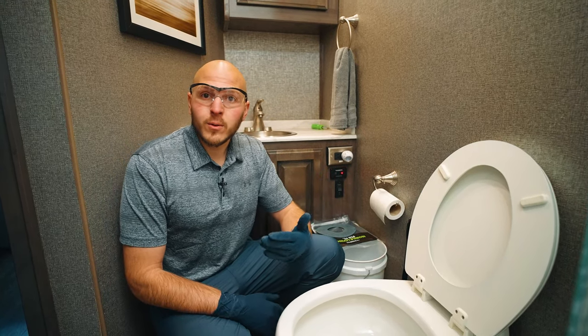With the winter freeze events of February 2021, we had a lot of customers calling saying they had freezes and leaks. Two things can leak on your toilet: the vacuum breaker in the back, or the water valve behind the pedal. A good rule of thumb — if your toilet leaks all the time, it's usually the water valve. If your toilet leaks when you flush, it could be your vacuum breaker because the water travels down the supply hose. We have all those parts if you need them.